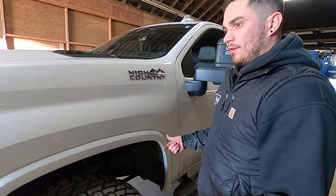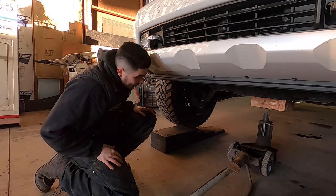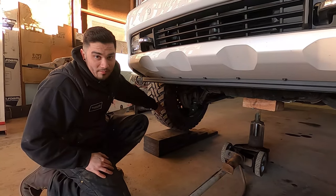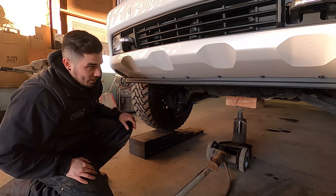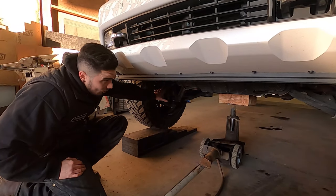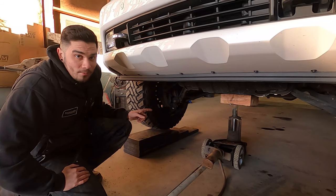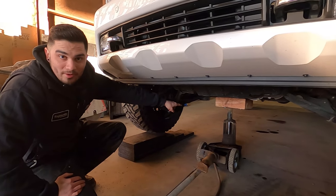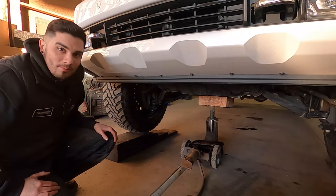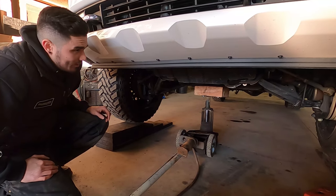Now that we see the clearance, I'm gonna get this thing off the ground, adjust the keys, and remeasure. Ideally get the tires off the ground because then all of the weight is off the suspension. We maxed out our jack with these ramps — hindsight 2020, we shouldn't use ramps. This takes all the weight off your suspension; you'll know if you didn't do it right because these keys will be super hard to turn, and it's really hard on the knuckles up front.